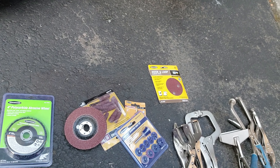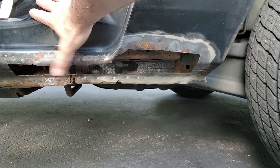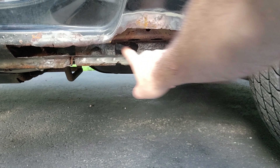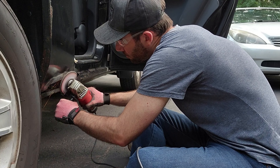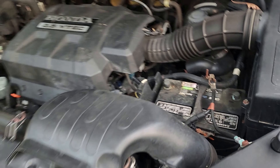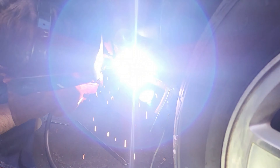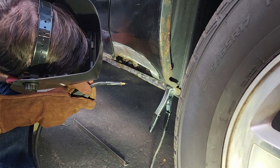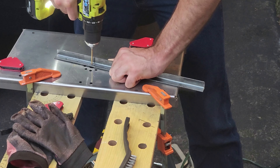It's the next day. I bought a whole bunch more sanding gear — I have a flapper pad, the angle grinder, some small bits, some round ones to get into some of the finer areas. My goal is to get it all cleaned up and prepped for welding, and I want to weld at least one piece in — I want to weld that inner angle iron into the inner structure. I disconnected the battery because I'm going to be grounding to the body of the truck and I don't want to mess up any of my electronics. I'm going to use this piece of angled steel to strengthen what was the pinch weld and to brace the jacking point for the truck. I'm drilling a few holes at key points so I can do some spot welds.